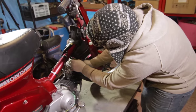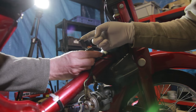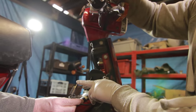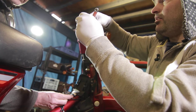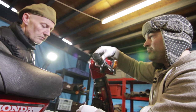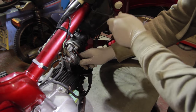Let's take the throttle pin out. This is the slide — what lets the air through the carb. This is the pin for mid-range. You have a pilot jet in your carb which works from no throttle to a little bit of throttle, and at half throttle this pin comes into play — it's tapered, so as it comes up it lets more fuel through. At full throttle it's called the main jet — that's when the throttle's fully open and no more fuel can go through via this, so it swaps to the main jet, which lets a lot more fuel through.